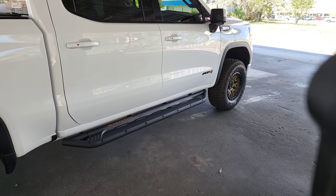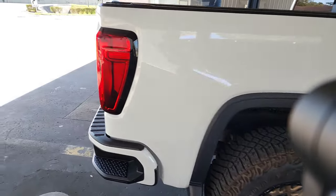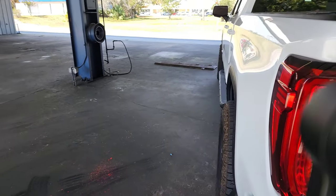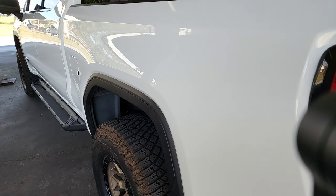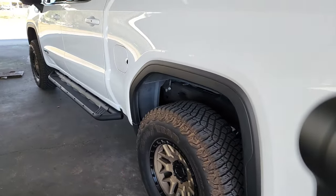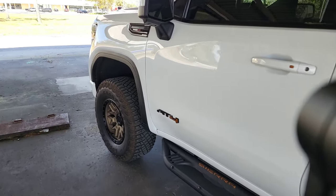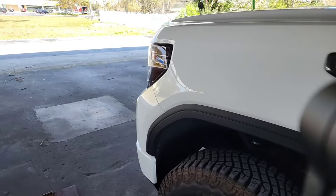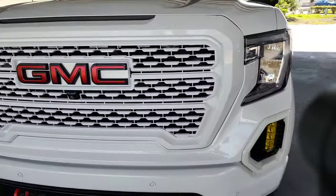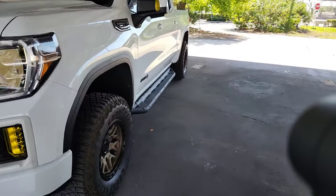The next step is they have to order the leaf spring and replace it. My dealer did not have the leaf spring in stock — it was about a week out — so I had to pick my truck up and drop it off again. They replaced the driver-side leaf spring, and that clunk that happens when you drive over something off-camber, either left or right, was absolutely gone once they replaced it.